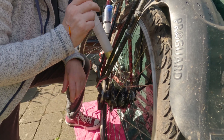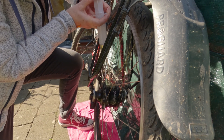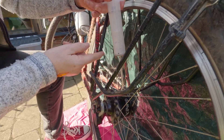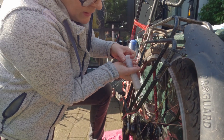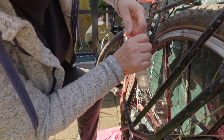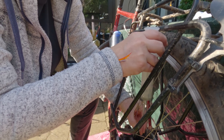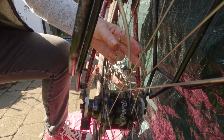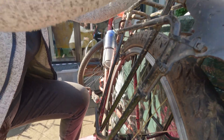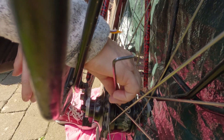Now we're going to insert the oil into the hub — bring on the nurse again and just plunge that in. Once the oil is in, we need to balance the air pressure inside, so we're going to extract about 25 millilitres of air. That should be about right, and then in reverse we remove the syringe. Pick up your allen key and very carefully put the drain nut back in position.